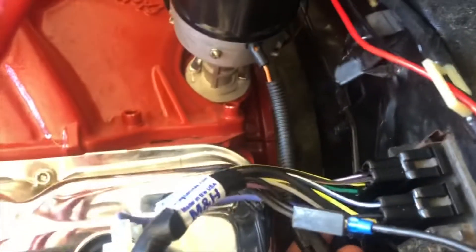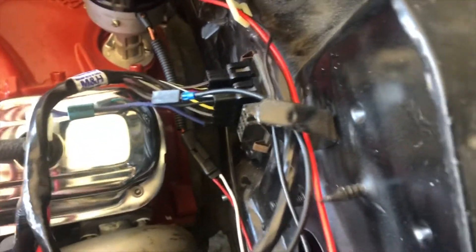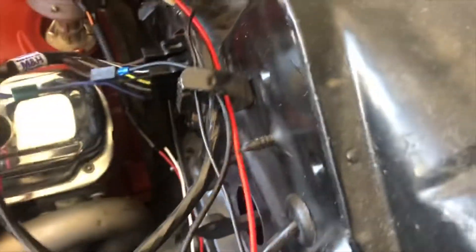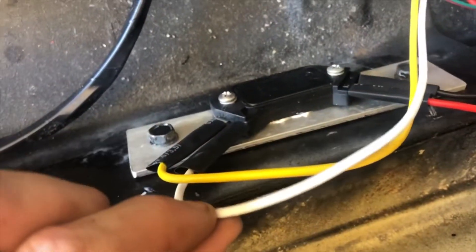Then you got your distributor plug, and this is orange and black, but I didn't have any orange wire and I didn't want to run another black wire because I'm already using that as a ground. So what we did — I got yellow wire and this connector is red, so we figured yellow and red makes orange — that's how we'll know it's the same wire, and then white to black. So what would be the orange wire, we used yellow. If you look at W, that's where it goes right there. And then this white wire, which is the negative for the pickup, goes to the other side. So that's it — the HEI is wired.